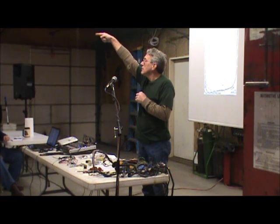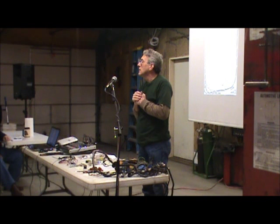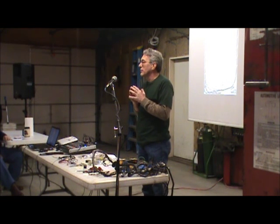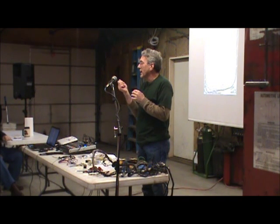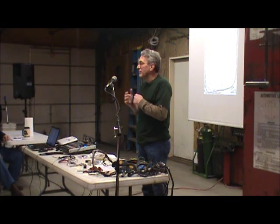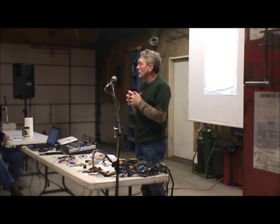To put an auxiliary plug in for a phone charger or a GPS, should they run an inline fuse off the battery? I would, and not cut into the wire behind it? If I was going to do it, I would find a spare terminal on the fuse box, for example. And you can get a piggyback male-female spade that'll slip on, so you could add a circuit without overloading your connections.